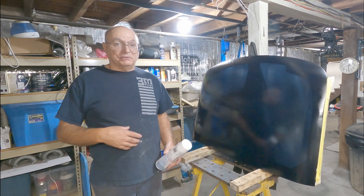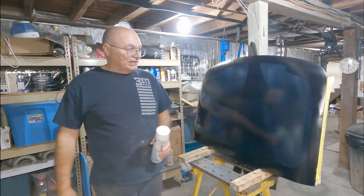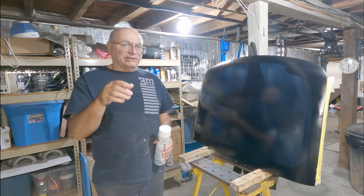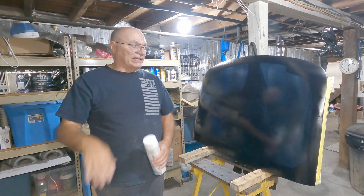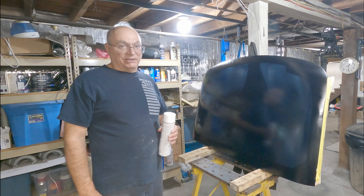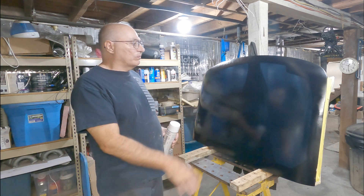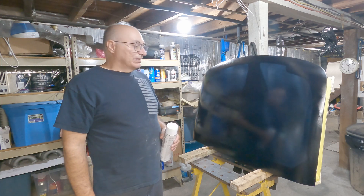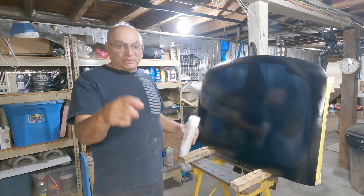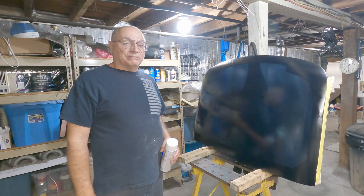I ended up putting maybe five or six coats on it. There might have been enough for one more coat but I decided not to risk running out midway. I also switched the tip — I used one of these tips from Eastwood aerosol sprays which has an adjustable spray pattern. The fan pattern on the included tip isn't really that great in my opinion — Eastwood's spray nozzles make a much better pattern. It's pretty rough looking right now and it's definitely going to need to be cut and polished, which we'll do in the next video. Check back, subscribe, like, share, leave comments — everybody have a great day and God bless.